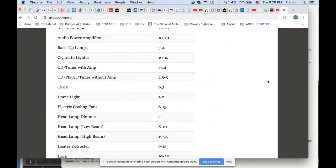When you're shopping for it, if you got an older vehicle, see if you can upsize the efficiency of that alternator. Find out what the efficiency of your factory alternator is. It might be great. Who knows? You might be at 85%. That's awesome. Buy it again. And maybe you'll find out it's 45% efficient if you can find any data on it at all. And then you might find an 85% efficient alternator. So now your engine is going to take less horsepower to rotate that generator to keep it running, to get the same equivalent power out of it.